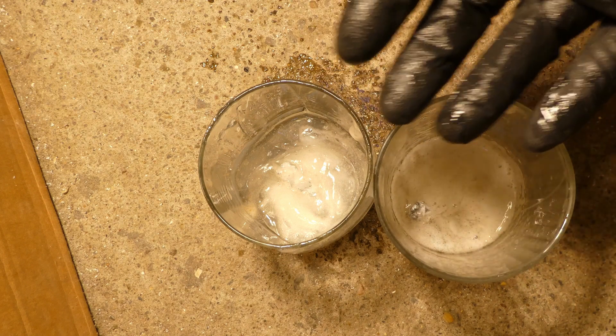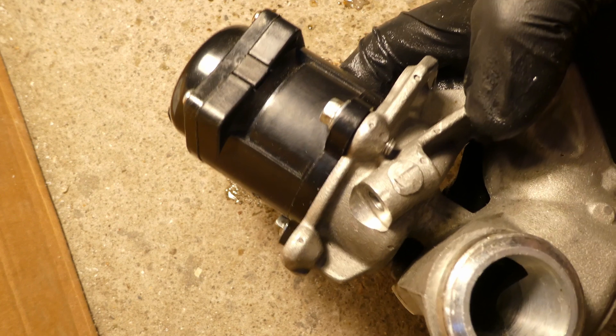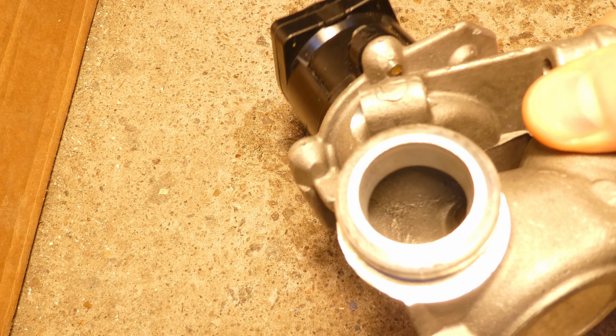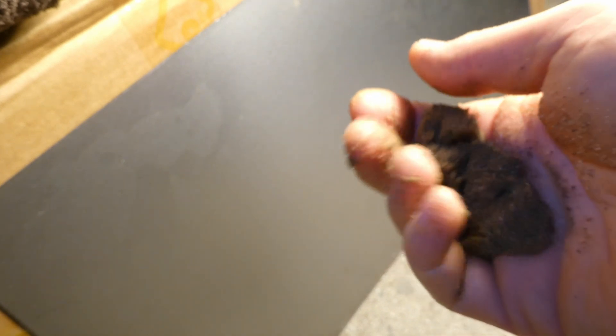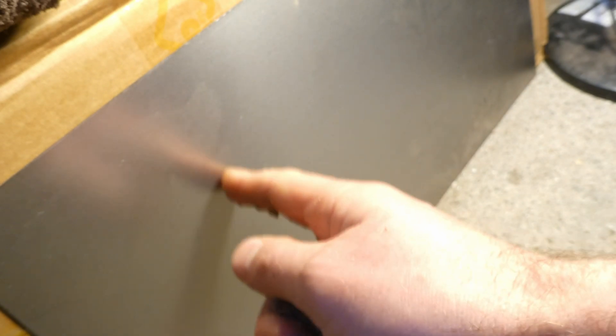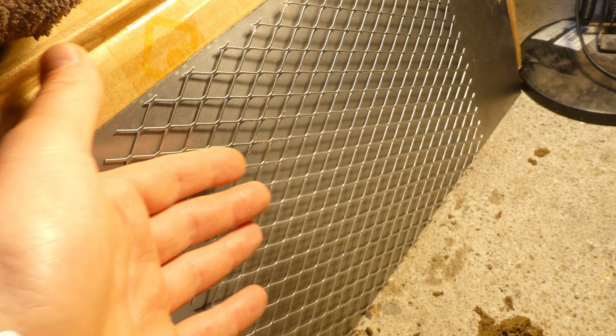I know what you're saying out there: 'But you kept it for an hour — I'll do it for 10 minutes and it will be fine.' Now, you've used the oven cleaner to clean your EGR valve and it will be really shiny. What you imagine is that the EGR valve walls are really clean and smooth, and that carbon particles will just bounce off the walls so the EGR valve stays clean for longer. But what is actually happening is this: instead of having smooth EGR valve surfaces, you have something like a perforated barbecue grill. The potassium and sodium hydroxide have eaten the surface of the EGR valve.